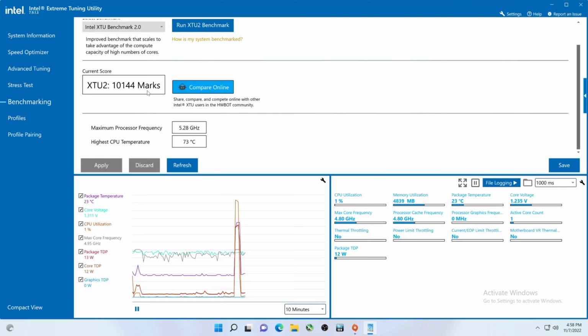Could it be that the motherboard is really all I needed? The VRMs, the power stages are better. I have to wonder, folks. I have to wonder. Let's check out some things. Core voltage. So depending on what motherboard we've seen, you know, differences here or had to boost this. It's been crazy the stuff we've had to do with 13th gen. Alright, so that was pretty darn good, folks. This makes me think that we are not going to have a problem with thermal limit throttling with R23 when we get there. So we'll clear this out.